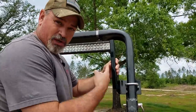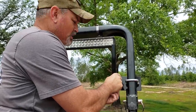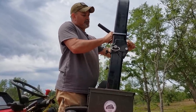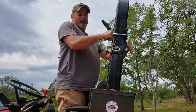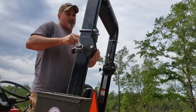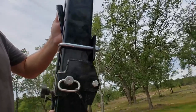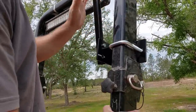We add the strut to the mounting bracket. We're only going to put the top bolt in first. Put this strut on the bracket using a 9/16 wrench and a 9/16 socket — an impact driver will make it go a little quicker. You're only going to put the top bolt in first. So far it's been super easy, no issues, pretty simple and intuitive. I'm not going to tighten it all the way because I want this strut to move so I can do some adjustments, and after I get it where I want it I'll tighten it down.